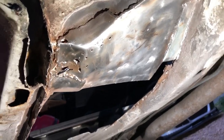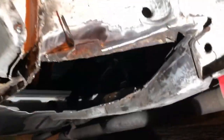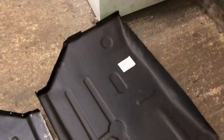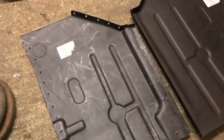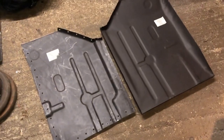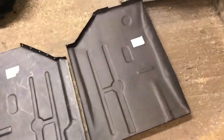If you think this is unusual, it's not. All the RSs out there are like this. I don't care if they're 15 grand or 30 grand, they're all like this. So I've obviously cut out all that crappy welding. You can see where they've welded over the top of rust - there's the weld and there's the metal. The brand new panel obviously comes pressed and it's just a terrible fit, so it takes a lot of work to get it flat and to fit perfectly. You can see the difference between the two panels - the left side looks like factory and the right side is not very good.